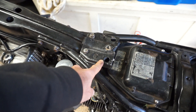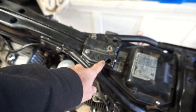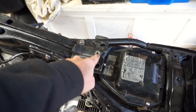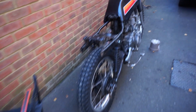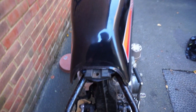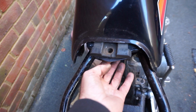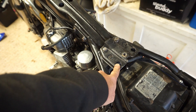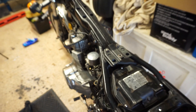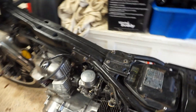I've just noticed something - the Super Dream has got this bracket on it which is for the extension for the seat, and that's actually where the tank bolts in. If I were to take that bracket and put it on the scrambler, which is currently holding Flint's fuel tank, that would extend the mounting right back to approximately where I'm thinking it needs to be. That would give me much closer to the clearance I need at the front. So I need to source one of these brackets, or make my own equivalent - that's what I'm missing, that's why the tank's in the wrong place.